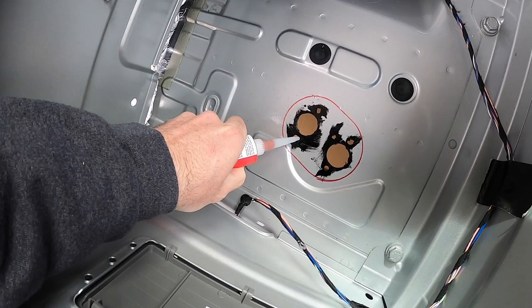I'm not sure what happened to the audio here, but this is when I'm starting to put the fuel line together — creating the adapter connector piece that will go into the fuel tank, then sizing down to the hose connector that fits the blue fuel line. It's easier to do this out from under the van. I have two pieces I tighten down, going from big to small. I get them nice and tight so they're not going anywhere.